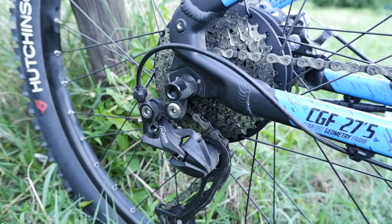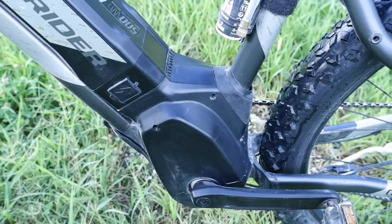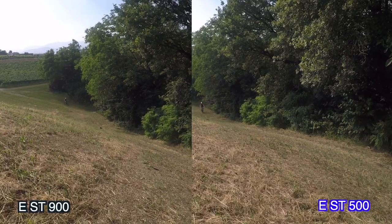The big difference between these two bikes is the motor. The Rockrider ST500 has a rear hub motor, which is much more basic compared to the mid-drive motor found centrally on the Rockrider ST900. In terms of riding feel, this made a huge difference — the mid-drive motor on the ST900 gave me extra sprint, and especially off-road I felt the real benefit because it's a smarter motor that follows your pedaling more closely and especially on steep sections where the ST500 struggled, it pulled me through.